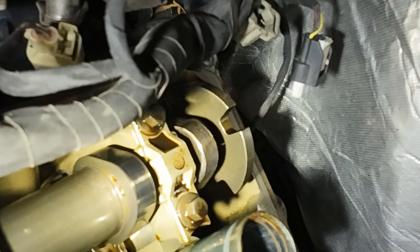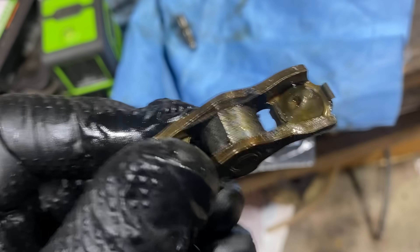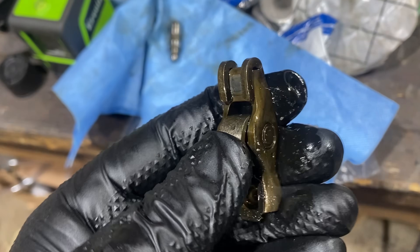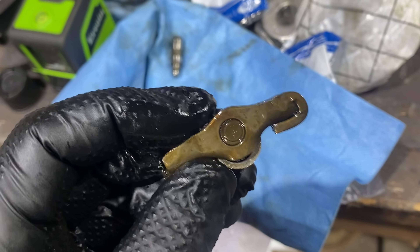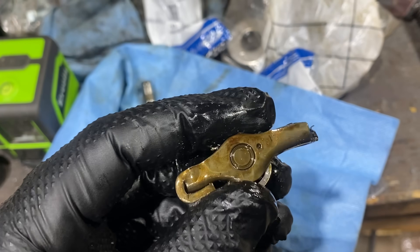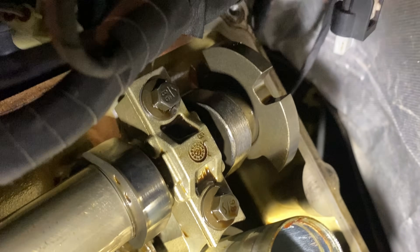Got them out. The lifter looks fine as usual. The rocker bearings are stacked up on each other, and then the cam lobe gets into this, tears up the sides of the cam lobe, and wears on the surface where the roller is supposed to ride. Interestingly, this is the furthest valve back on the intake cam — and 12,000 to 15,000 miles ago, this truck did the same thing on the exhaust side. So does Ford make crappy rockers? I would say typically yes with these engines, but there might be more to the story here — like this head has an oiling problem — because stacking two failures right next to each other does seem pretty coincidental.